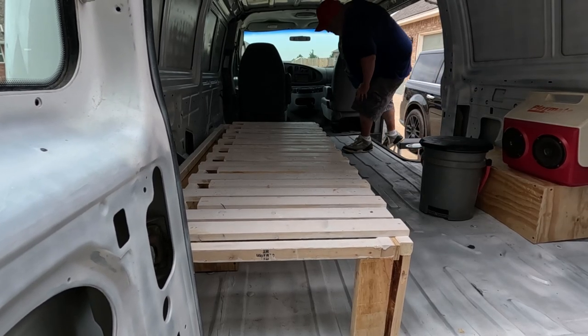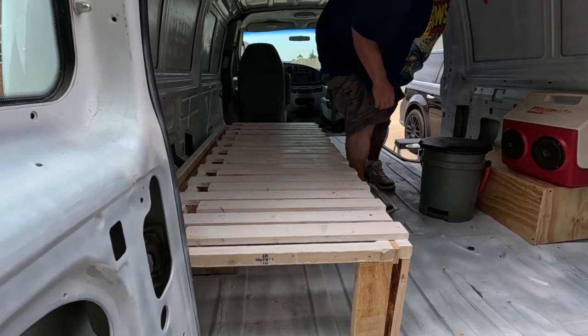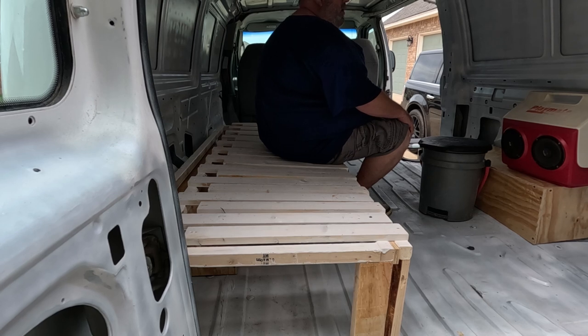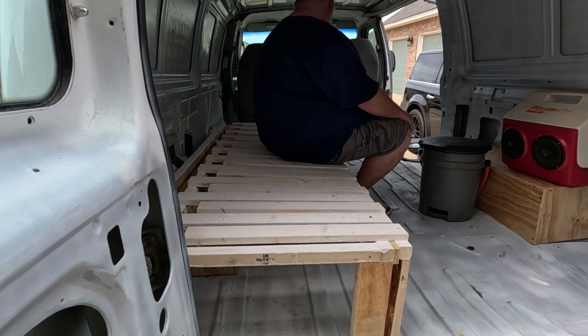So this is the final test, and I'll tell you right now, it's not perfect. The biggest problem that I discovered is that the 2x2s that run long ways, the 6-foot long ones, have a little bit of give in them. I probably should have used 2x4s, but instead what I think I'll do is add a support leg in the middle. This van has a lot more work that needs to be done. I need to add insulation, I need to finish the walls, I need to put the floor back in. I've got a lot of things, but I'm gonna tell you right now, my next video, I will be sleeping in this van.